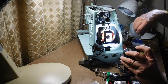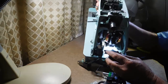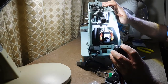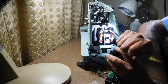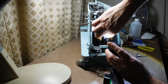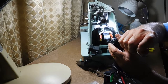I always lay the machine on its side to do this because it gives me a better view from the bottom of what I'm doing, instead of trying to look in here and see where my screwdriver is going and how to disconnect everything. The manual suggests loosening this set screw first and sliding this post up out of the way to free the top of the motor. I'll put the set screw back in for now because I have a tendency to lose them.